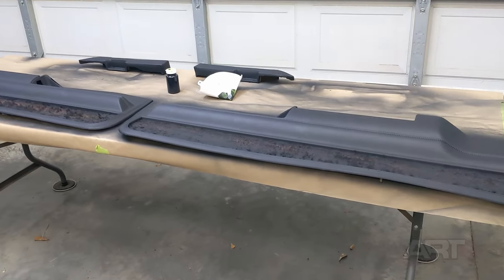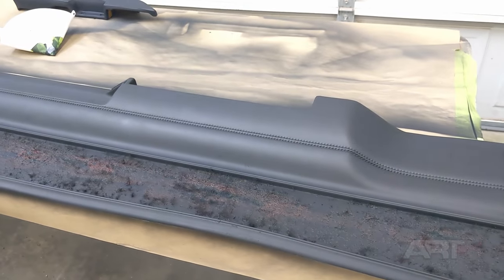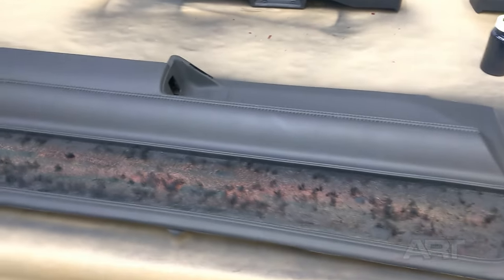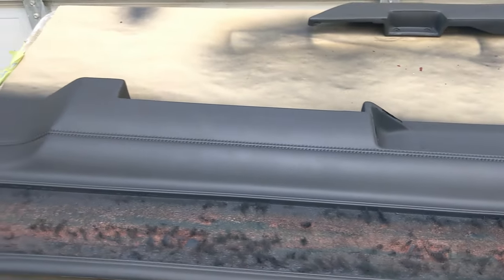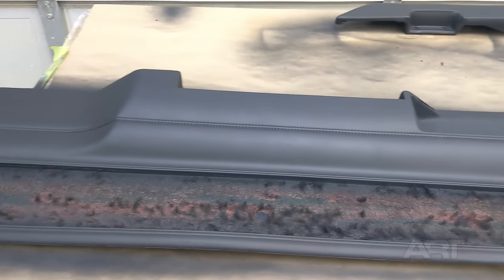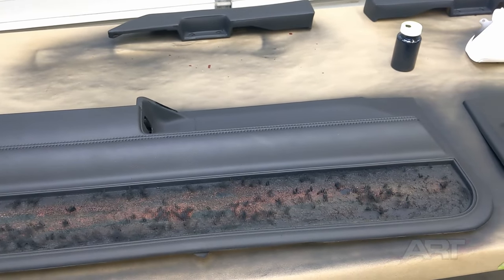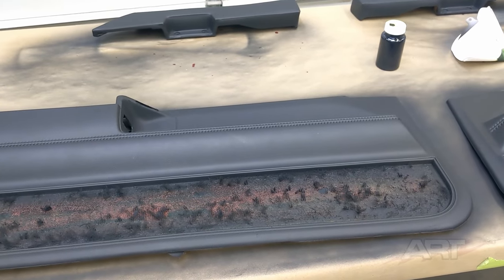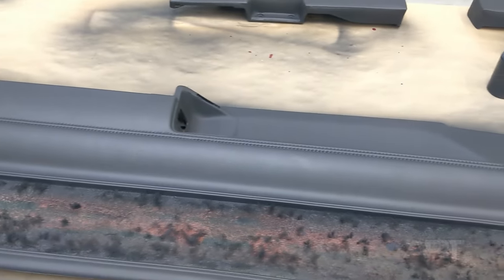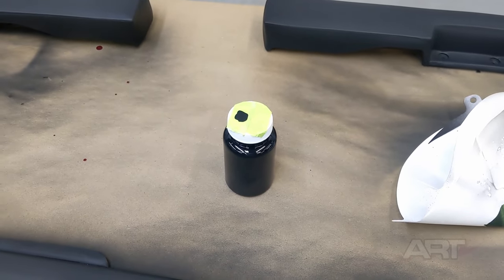Here's a brief tech tip. We had some plastic panels that we needed to change from blue to this very flat, matte black. Of course, we used our cleaning step aggressively with the gray scuff pad. We did a prep with alcohol. We did a prep with acetone. We put two light coats of adhesion promoter, and of course, since this was plastic, we used our plastic primer as our base for our pigments.